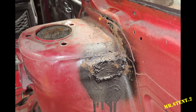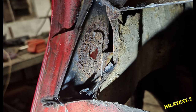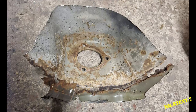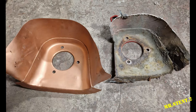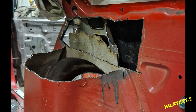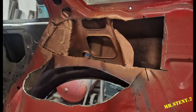I just thought I'd throw in a few pictures to give you a more detailed look at what the shock top was like. I had two lumps of steel welded into the front and back prior — it was an old repair and it needed to be redone. You can see the hole here just on the outside of the slam panel, or the valance, or whatever you call it. That's the shock top there. That's the new one and we did clean it up a little bit — that's the outside of it. We cut the rust off and made repairs as needed. Here you see them side by side. I had initially cut a small section out of the original one just to check what the internals were like and it revealed a whole load of stuff. It was in an awful bad way. So I just got the grinder and cut it out — you can see the supports. I had to redo all the supports as well. And everybody's been asking what the brown stuff is — it's actually weldable primer.